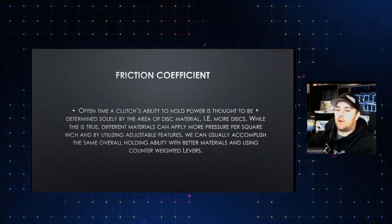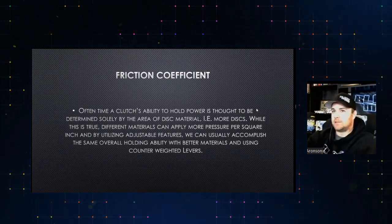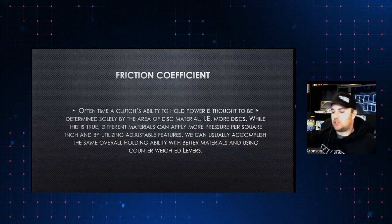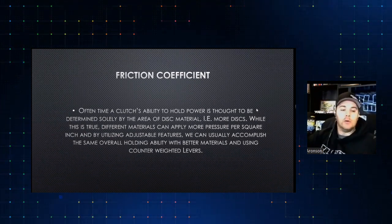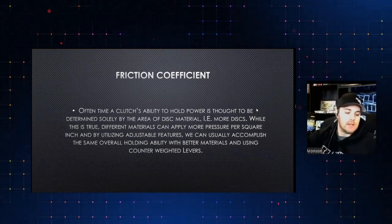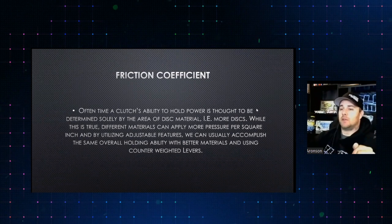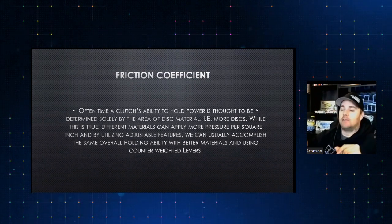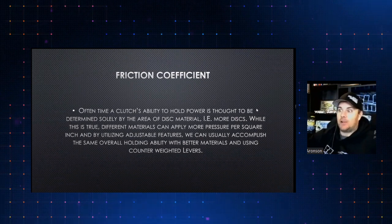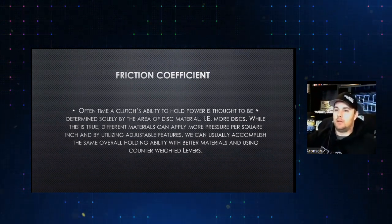When we go into floater plates, a floater plate has several things that can be brought out. You can actually see a lot of telltale signs of what's wrong with the clutch through the floater plate. A lot of times we actually have a customer right now, Tanner Bosnelli, who is working with one of his older units from one of the other manufacturers that he just had to open up and clearance some, basically because they encompass the entire stand that it goes on. So instead of having a lug with one on each side of a stand driving it, it has a hole that goes all the way around it. The problem is as they get hotter and colder, you end up with expansion and contraction, which obviously takes me backwards into talking about our heat shields.